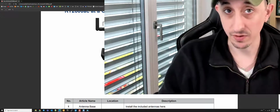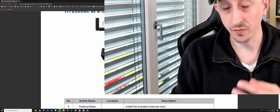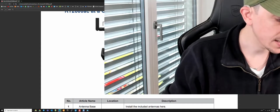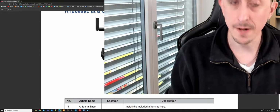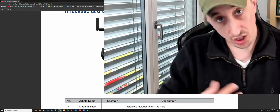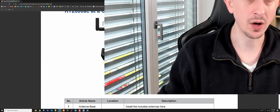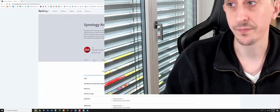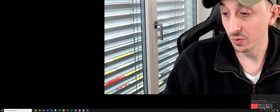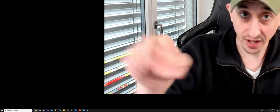I've just done a wipe and a reset. It's finished booting up. FYI, when you do the boot up for the first time or you do a wipe and a reset, the status light is going to remain orange for a little while. Be patient. Eventually it'll boot up and all of the other lights will turn green, and then you'll be at the point where we are right now. So moving forward, let us turn our Wi-Fi off. Let us re-enable our Ethernet port, the cable.